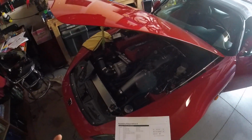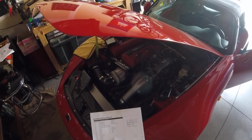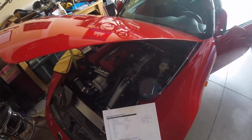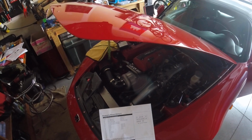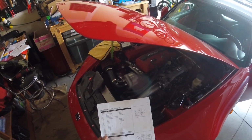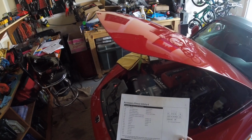What I've done is I've already wired it because I was using the gauge art CAN bus gauge previously, and I had already wired the pinouts to the gauge pod on my dash. So what I did was I just tapped into the existing wires to the gauge art cluster and connected it to the ID4Motion cluster. The sheet here shows you the pinout for the accessory connector.